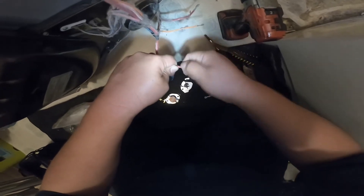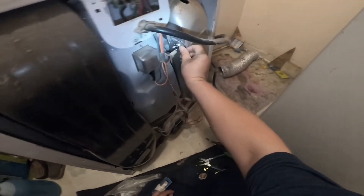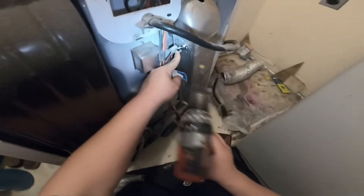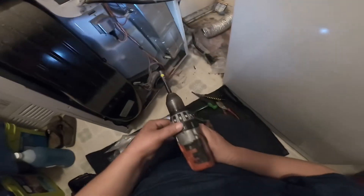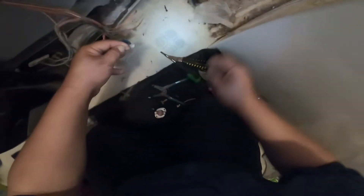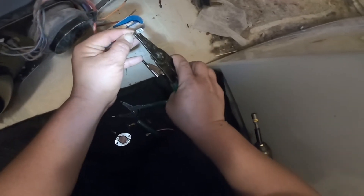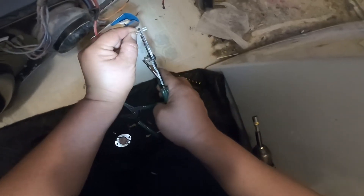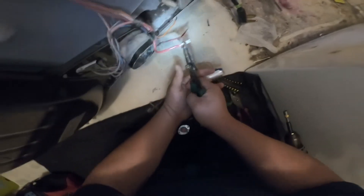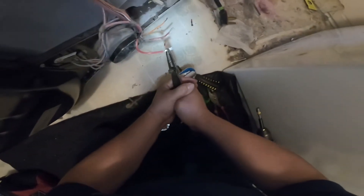Right now I'm trying to scrape the wire and I'm doing it with a knife because this wire end looks like it was overheating and it was not coming off with regular wire-stripping pliers, so I have to use my knife. Now we're going to replace the one on the top, which is the easiest one — that's the cutoff thermostat, the one that cuts off due to overheating and prevents the dryer from continuing to run.